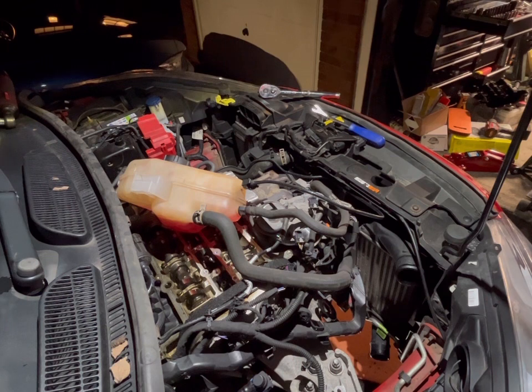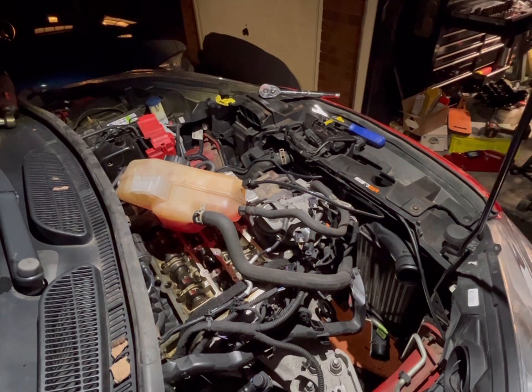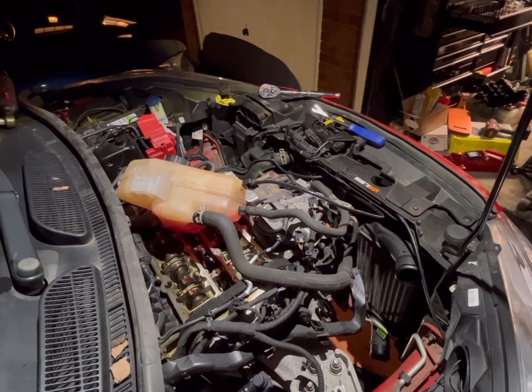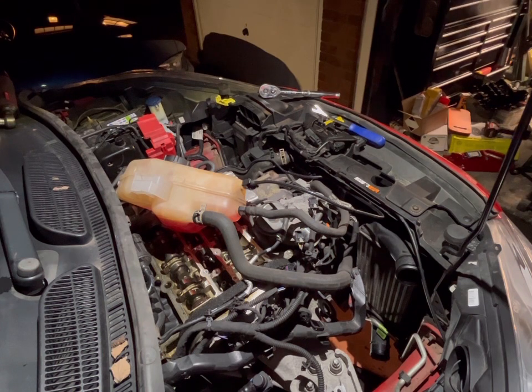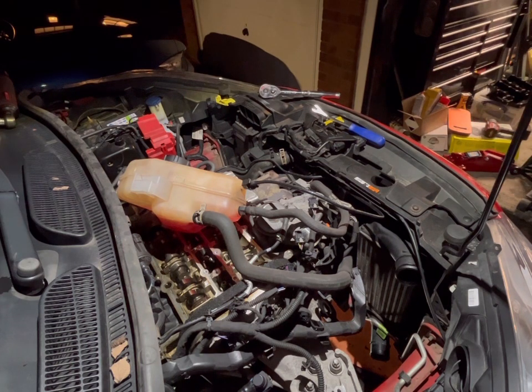So we're back in. Next up, what I think I'm going to do is disconnect the bottom radiator hose and drop all the coolant out — it's just a jubilee clip. I'll dig out my coolant drain pans because I have separate ones. We had a rejig in here and I lost track of everything — I remember where I used to keep it, it's not where I keep it now.